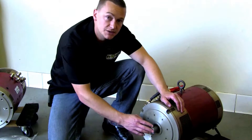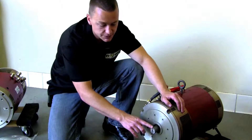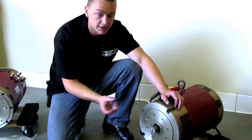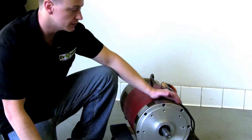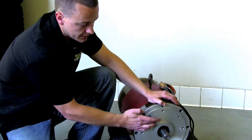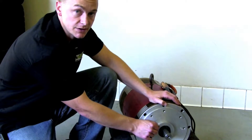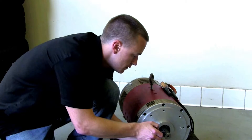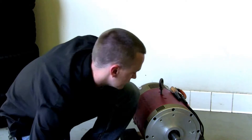As you can see, at the end I took the tool and just ground over the end and over the edge of the splines. That's to knock down any burrs or anything that would hinder the coupler from sliding on. Alright, we're finished with the first motor. Let's go ahead and do the same thing with the second one. You want an inch and a half from this face here out, or you can do an inch from this step which is already a half inch out. Now our mark is set — let's go ahead and cut it off.